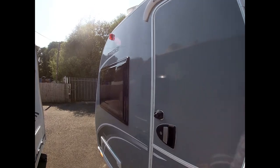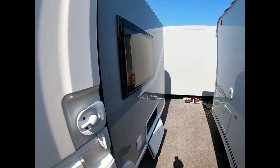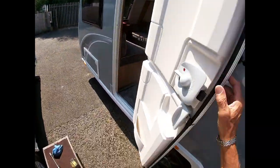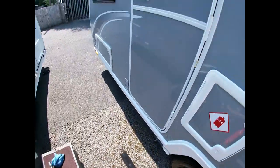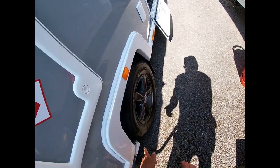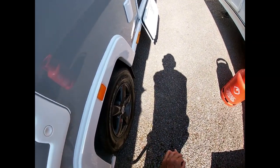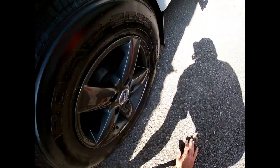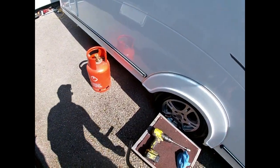And now we come to your motor mover. When you come to collect your van, you'll find all your handset for your mover just sat inside the door there like so. Now, the first thing we're going to do is engage our mover. We do that with the bar provided, making sure that it goes straight on, all the way on, and we come up and push, and you can see that's engaging that mover. Use a firm push, flat of hand, just in case anything slips,